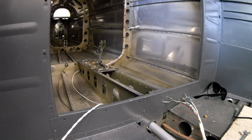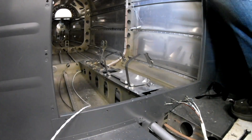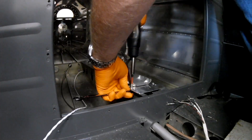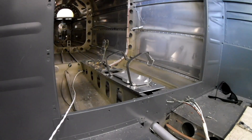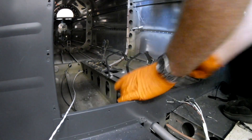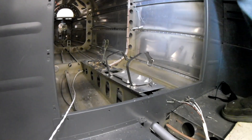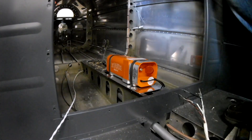Now that it's mounted, the only thing left is wiring. I've got positive and negative power coming in just to keep the battery charged — it draws about 0.1 amps, roughly 1 watt. Then I've got one data cable coming from the GPS to the ELT, because it's a 406 MHz unit and that transmits your GPS coordinates when it goes off. And there's a phone line — an RJ11 plug — that connects from the ELT to the little test squawk device, then runs forward to the panel-mounted test and arm button.